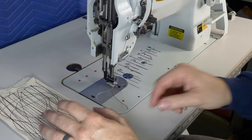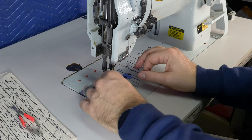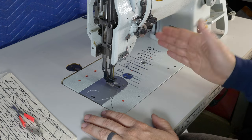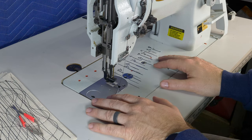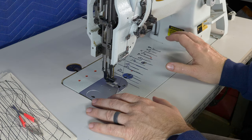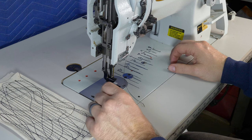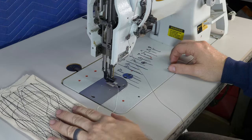This machine came in locked up. We took it apart - it started moving okay after we got the feed dog freed up, and we were able to start getting it to sew again. We half-split it to figure out exactly where the problem was. The clutch probably needs to be replaced - I'm going to talk to the owner about that. It's sewing great and making great stitches. Hopefully this machine will no longer be the one they hate and will be the one they love to use. Thanks for watching.